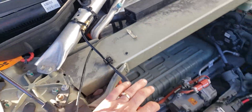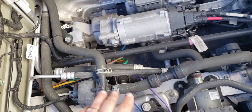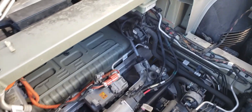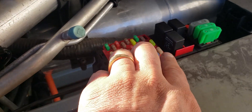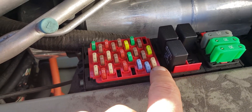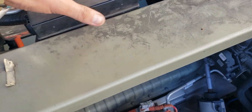After I did all this, nothing really worked. This is your pump, and there's your solenoid block right here — that's what controls the suspension. It wasn't working; the car dropped to the ground and we had to drive it like this for a while just to get here. So what do you check when this happens? There are two fuse boxes right here. Open this up — this fuse right here, the 25-amp F36 fuse. I checked it and it was good.